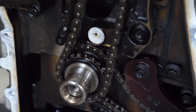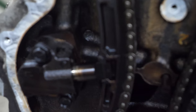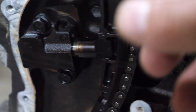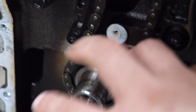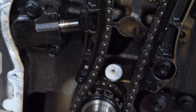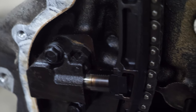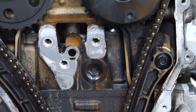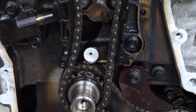Pretty varnished but not terrible. Because the crank is not keyed, the timing chain tensioner is not always a good indicator of how stretched a chain is. But you can see this tensioner is completely extended. It's been my experience that you usually don't get this much movement in one of these engines. It is pretty dirty in here — I don't think they changed their oil super often, but I've certainly seen worse, especially on CX-7s.